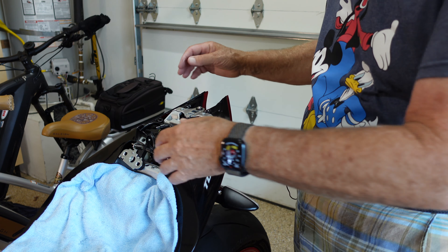We're only going to be using these two mounting screws when we put it all back together again. Now comes the fun part: we're going to put it back under the tail of the machine. We have to thread the light connector back up through the tail and attach the right and left hand turn signals. There's a slot provided in the Moto Dynamics kit that we fit those through so they don't get pinched. The right hand turn signal has a red wire - so it's just the reverse. To keep the inner nut from falling off the bolt, just put a little dab of grease on the inside of the socket and it won't fall off. A little tip from yours truly.